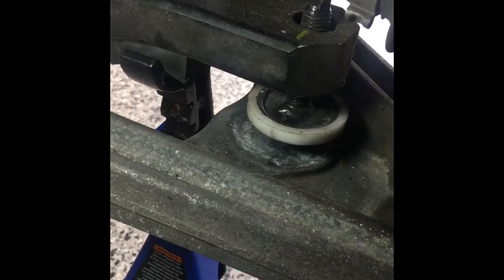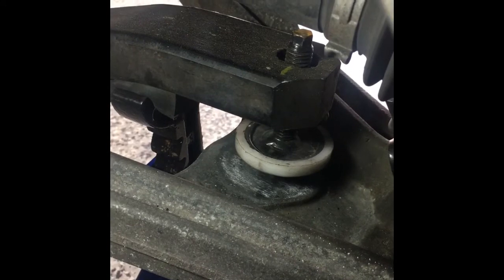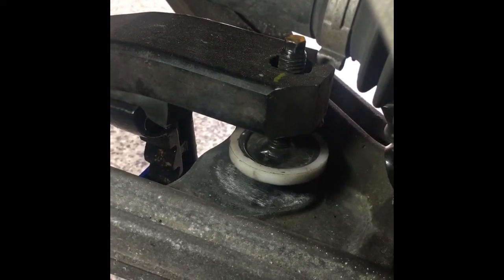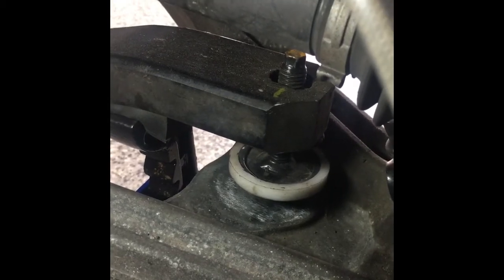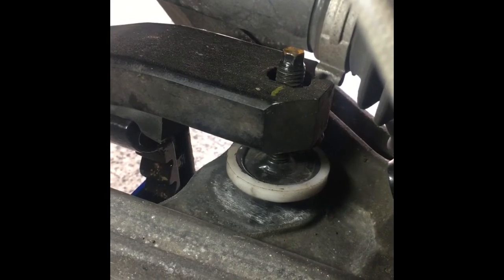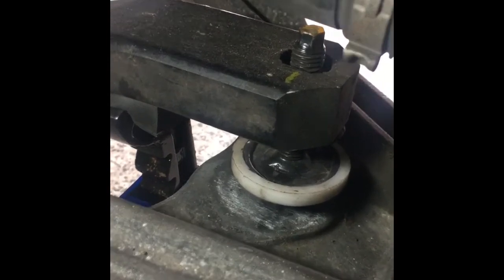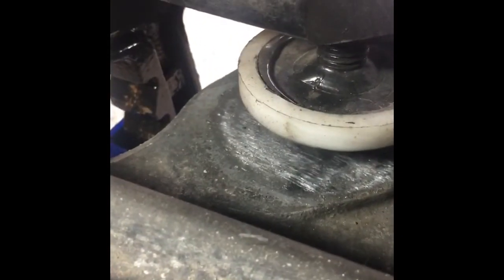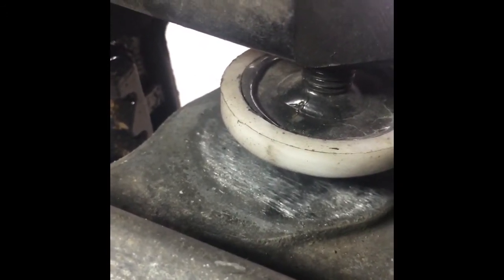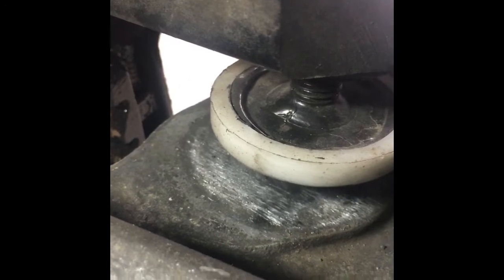The pads I have, as indicated in an earlier video, are T1 lowering bolts, so they're designed for racing. They have a Delrin pad on it, which is great for durability, but wow, these things are loud. Sounds like an old wooden ship going down the road. You can see some of the scratches in the A-arm. This is from me cleaning up some gouges from previous pads that failed. So far these ones are rock solid.